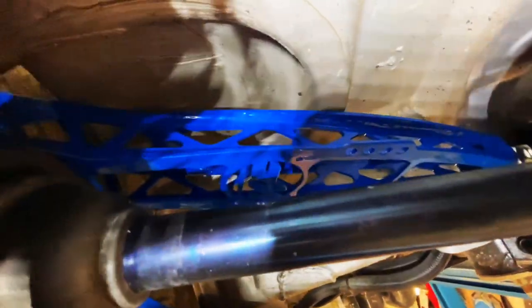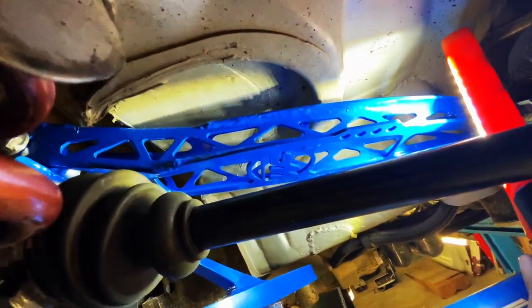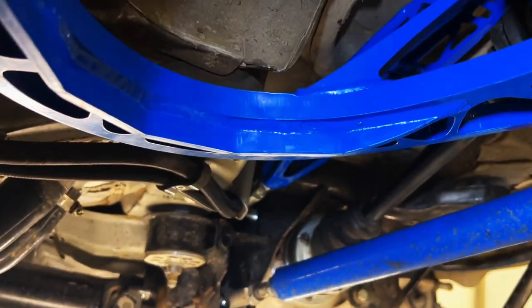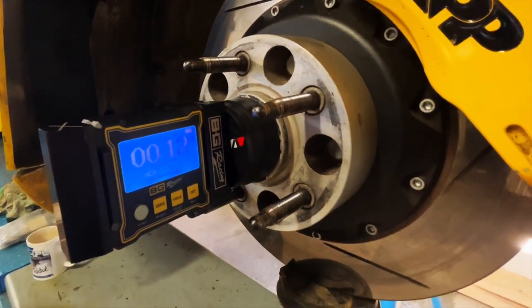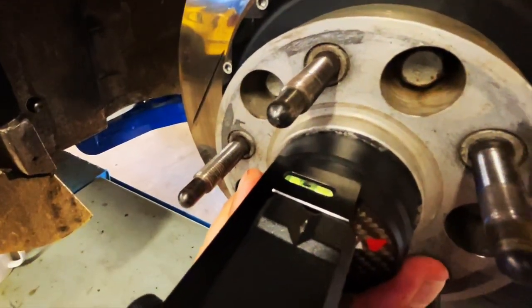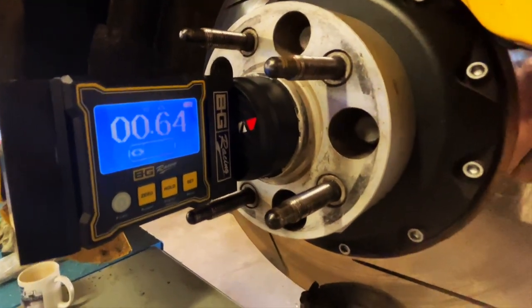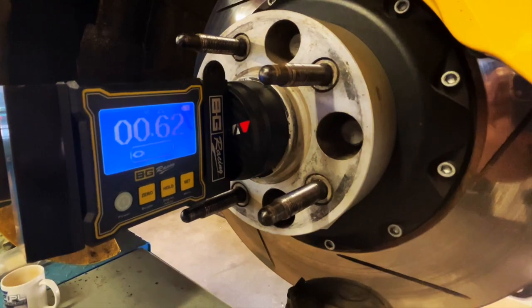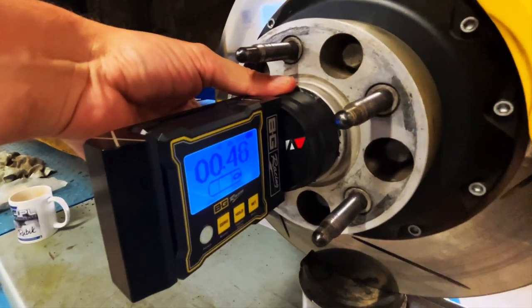With this setup you're also getting the most travel you'll ever need on this chassis — this is overkill. If you know anything about E46s, you know that if the wheel bearing sits at skirt level that's already super high. A 265 will hit the highest part of the inner fender; there's absolutely no need for this much travel, but you can really lower the car very far and have a lot of bump travel. This is the V2 obviously. If we move the suspension all the way through its motion — all the way up and all the way down — there's very little camber gain. This is way more travel than you're ever going to use; it's basically the physical travel that no shock could even keep up with. There's almost no change in degrees of camber — this is about as good as it gets with any car.